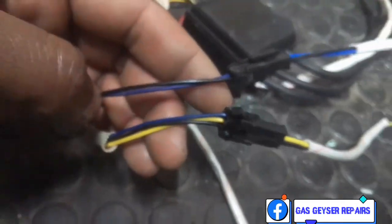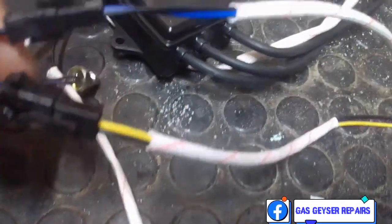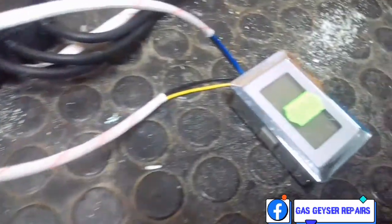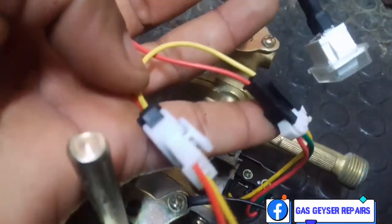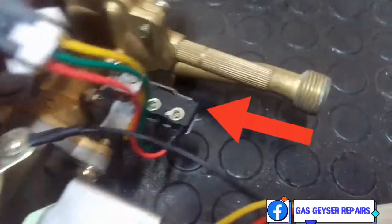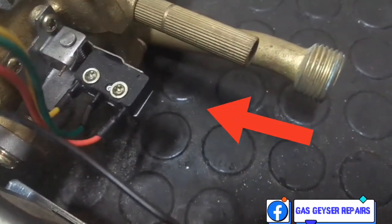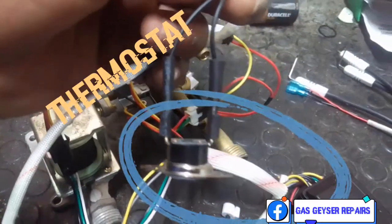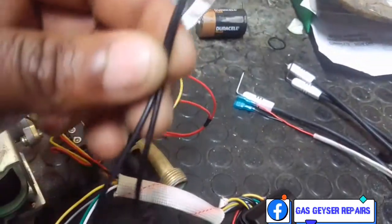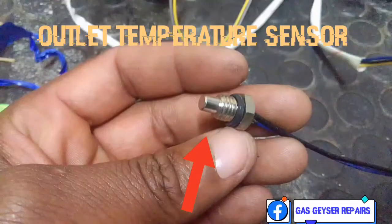As they are connected, the color coding is there — you can see the coloring. You get your micro switch wire connected to the on/off switch, then straight to the micro switch. The on/off switch bridges the two to connect to the box, and then you get your thermostat which is your heat sensor.